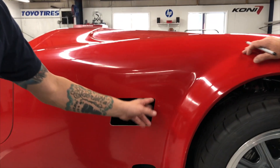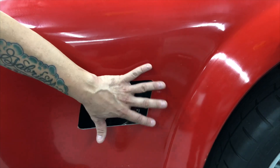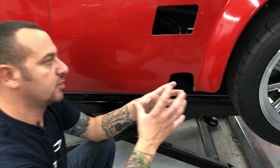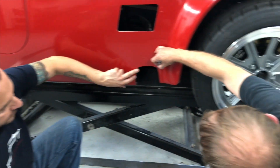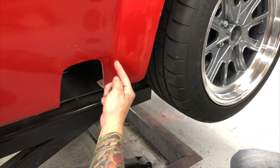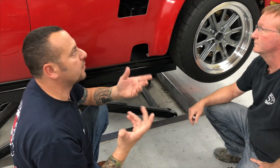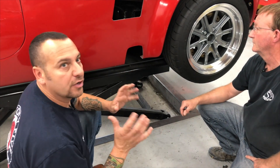Side vents — we go to our side vents. They're actually trimmed pretty nicely. What I do is we actually roll these edges a little bit more, but they do a really good job on the side vents, so those are pretty much set in place. For the exhaust cutout, everybody's worried about the exhaust cutout. In the last video we changed our headers over to a ball flange, so we have a lot more movement in this header — front to back, up and down, side to side — which is going to help huge. This is going to want to be opened up a little bit. We're going to make this a little bigger when we start trimming. We'll go right to this finished lip. We do have a car in the showroom we'll do a comparison on, so you guys will see the difference of when we say leave a quarter-inch roll — it's night and day having that little quarter-inch roll there.